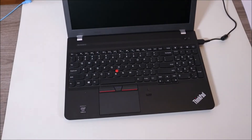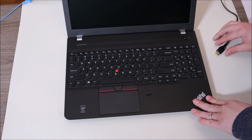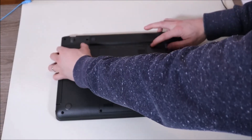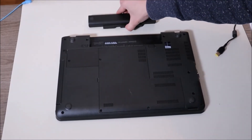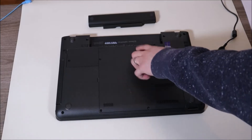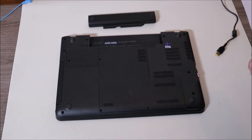If that doesn't solve your issue, now we're going to move on to step two: we're going to unplug your charger, flip your computer over, and if you can, remove your battery. If you can remove your battery, that's the better thing to do here — it's a better way to perform this test. If you can't remove your battery, you can try doing this test without removing it. If you do want to do this test the right way and your battery is internal and you can't get at it easily, there'll be a video in the description below on how to access an internal battery.